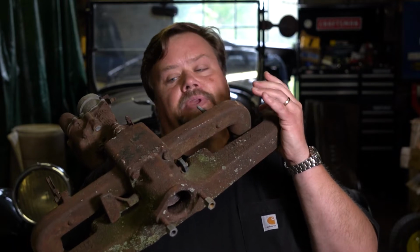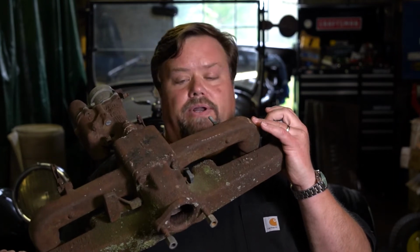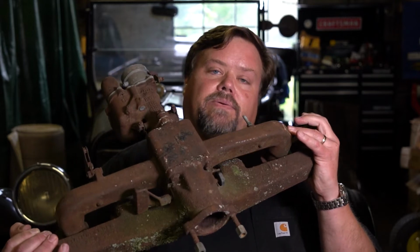But the key is the high heat coating allows this carburetor on the top to be more efficient because the high heat coating prevents those thermal cycles from getting too hot and allows the vehicle to run at a more stable temperature throughout its run cycle and ranges. So there's a benefit besides the cosmetic and protection, but on some of these older vehicles, there's some mechanical thermal qualities also for a quality high heat coating to be on your intake manifold and of course your exhaust manifold.